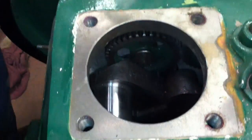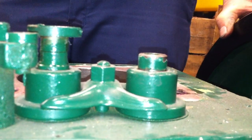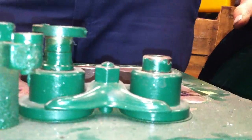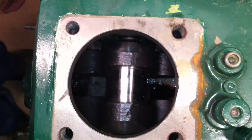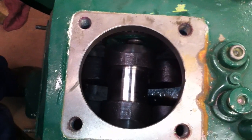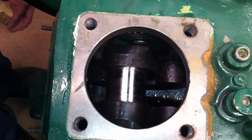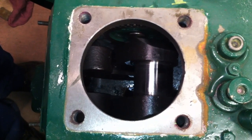Now we're going to check, watching the lifters very closely — don't pay any attention to your crank. Go back and forth. See, they're both moving. Now I'm going to stop right in the middle of that overlap. Allen's going to bring the camera back up right on top — look straight down in. That crankshaft is obviously right in the center of the bore. This engine is in time. If we were off a tooth, that crankshaft would either have to be here or over here — obviously not in time.